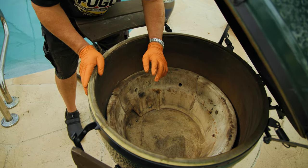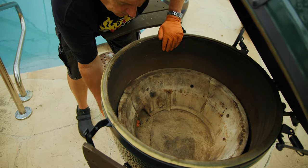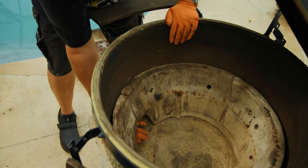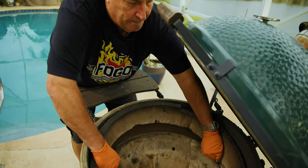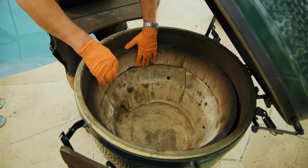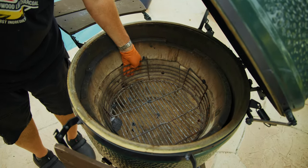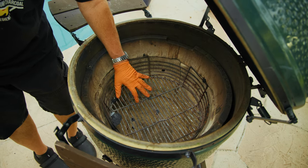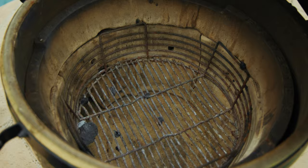Some simple reminders as you're putting this back together: when you put the fire bowl in, make sure the hole in the fire bowl lines up with the hole in the front — you want as much airflow as possible. Also, we're going to replace the old basket with a kick ash basket. These things work like a champion — they increase airflow and make cleaning out much, much easier. There's a link below to get one. Make sure you're putting everything right in the center of the grill so you have the same size space all the way around your fire ring and fire bowl — about a quarter to half inch gap all the way around.